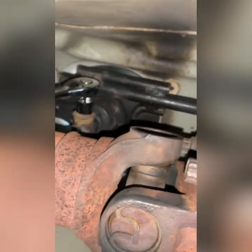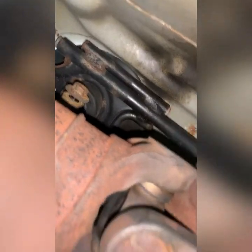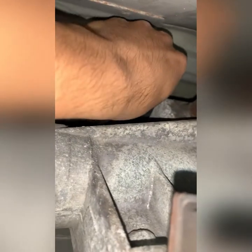I'll get back to you guys. There it goes — bolts are already loose. I'll take it out; this one goes directly to the transmission. It's already loose. Socket size is 10, by the way — actually, no, size 13. This one up here is already loose — that's a size 10.